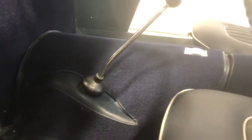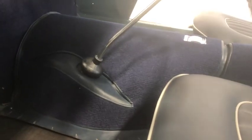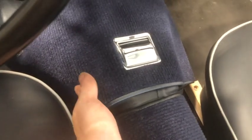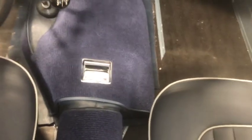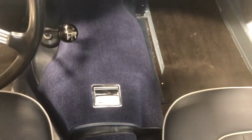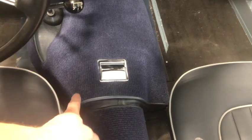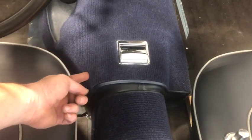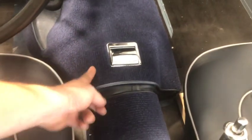And then this being the second style, it's this pressed aluminum panel. It's two pieces that are riveted together down the center. And it's distinct in that right here, where it does a dive down, this is perfectly flat going straight down. And so that's the second style. You can see how flat that is. But this style apparently eventually started having problems because the overdrive solenoid just under the surface here was shorting out on this. If you hit any good bumps, it might cause them to rub. So they changed this style to a third style, and they added a hump. There's a big lump on the third style that clears that overdrive solenoid a bit better.